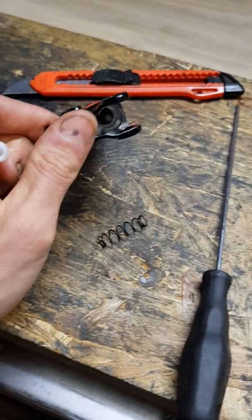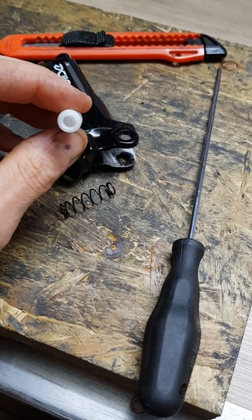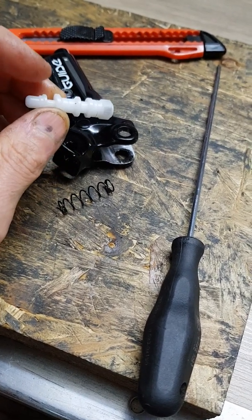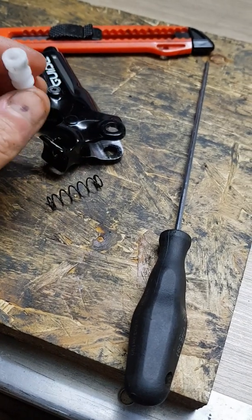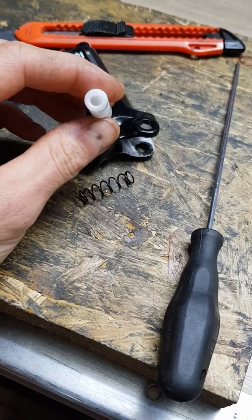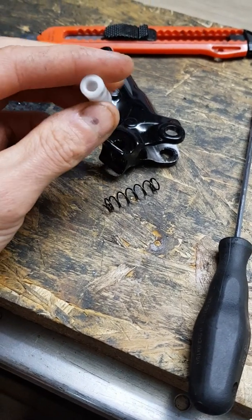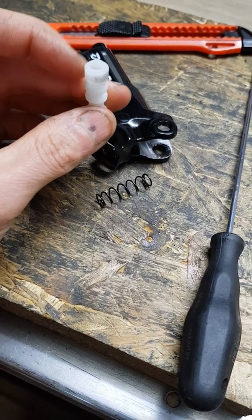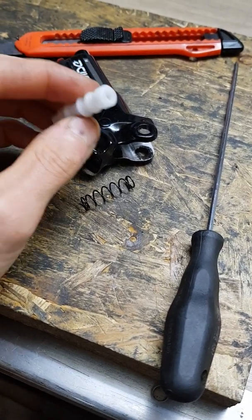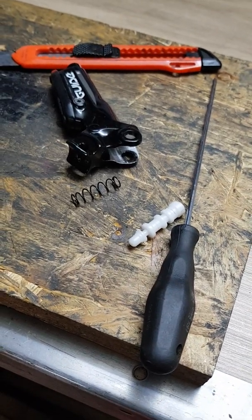Inside the hole we have aluminum as well. A synthetic oil like DOT 4 or DOT 5.1 can also have some issues if there is water or vapor present inside the oil, because this oil is hygroscopic — that means it's absorbing vapor and water. Water and aluminum material can cause oxidation, so if the piston were made from aluminum, it can be a problem. So we will try to make it from brass material with a special coating that we can test later on. It seems SRAM still didn't put their efforts to solve this problem.